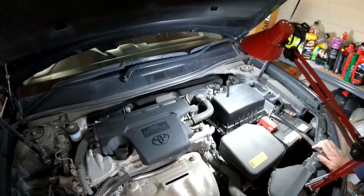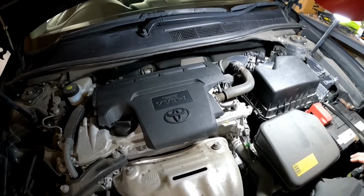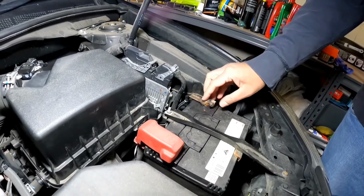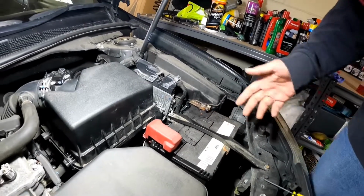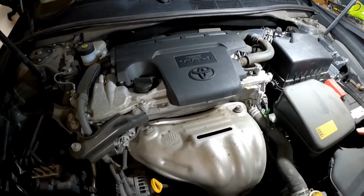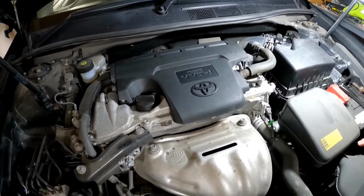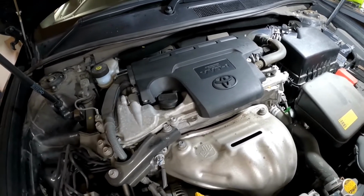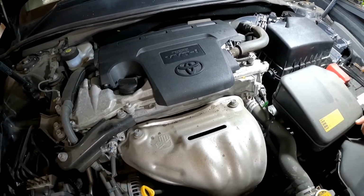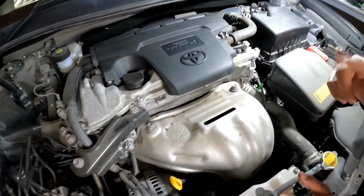Alright guys, just before you start this job, for those of you who are a little afraid that something electronic might go wrong with the vehicle, I would recommend taking out the negative battery terminal in your vehicle and just keep that down to the side, just so that no electrical gremlins come to your vehicle. Now, if you do unplug your battery and you leave it for more than 30 minutes, you could lose the memory in the car and it might actually stall the vehicle out. So I've got a specific video on how you can overcome that issue. I'll link that down in the description below, how you don't need to lose any memory in your vehicle by using this one specific great tool.